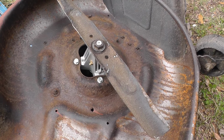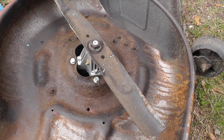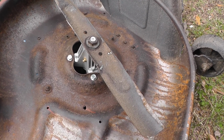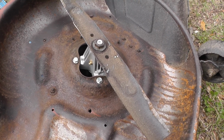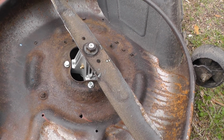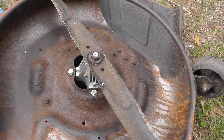Another thing on this spindle is I did not take the inner seals off the bearings. I just left them sealed because the original ones lasted 5 years, so I didn't see any point. And I think most people will probably do that. I just want to be sure you knew that the grease zerk wasn't going to do anything against sealed bearings.